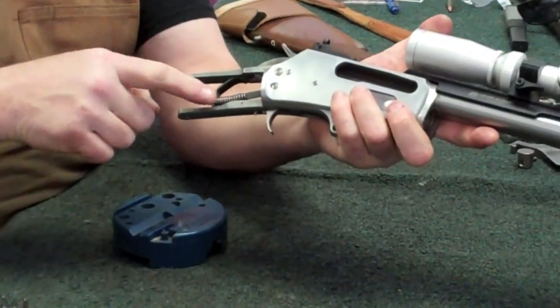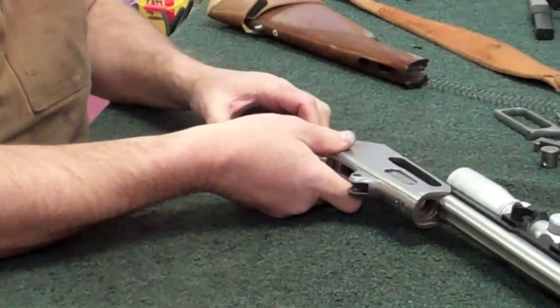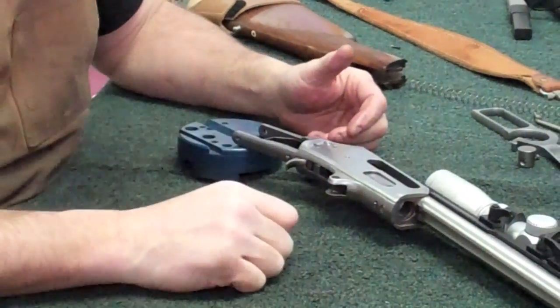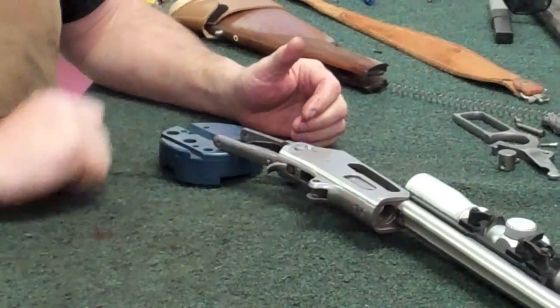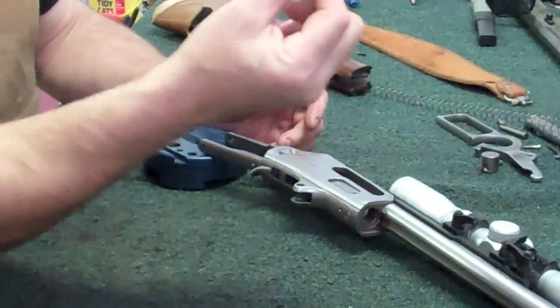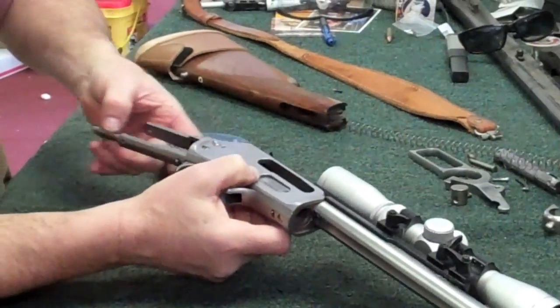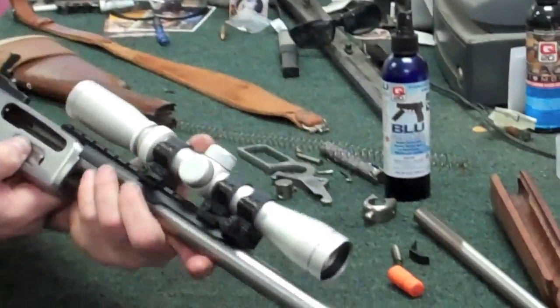You see your little hammer strut and spring and this little retainer right here? If it's really hard and you don't have strong thumbs, you can tap that with the backside of a ball-peen hammer. But what I'm going to do is just simply push them down and release that. There's your spring.